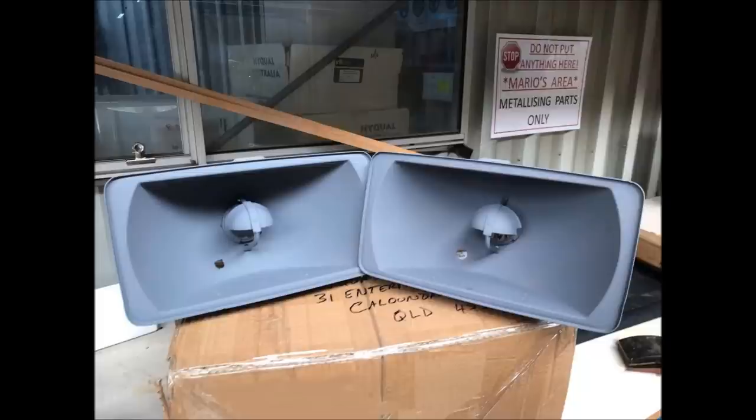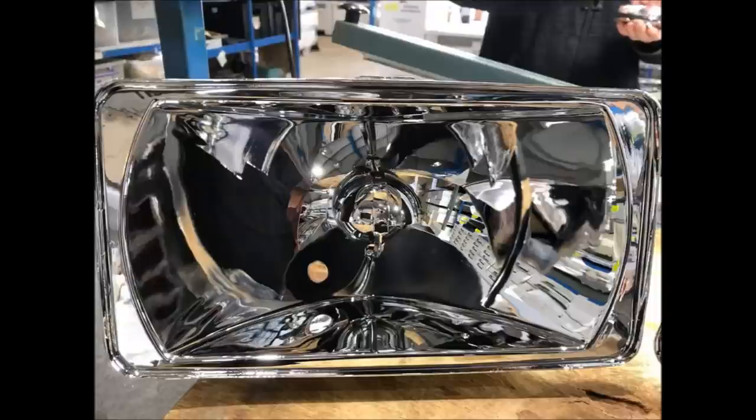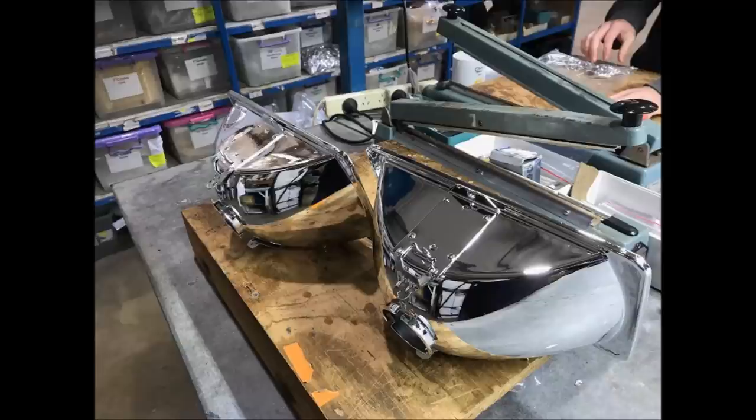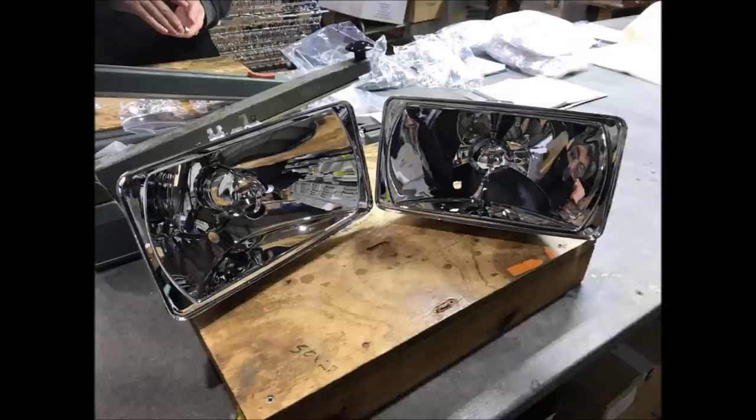These are then baked overnight and then put in a vacuum chamber of sorts and put on a rotating platform. And it's really interesting how they do it. There's the finished product there. They run 2,500 volts through these aluminium pellets, which disintegrates them or atomizes them. And they're on this rotating platter. And I think they're electrically attracted to the light reflectors, which give it this finish.